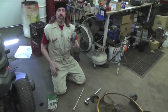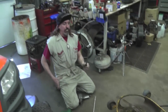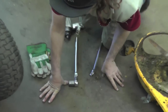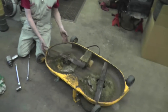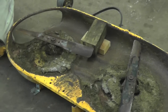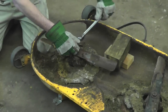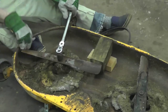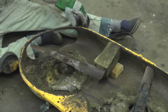Here at the shop we use an impact wrench on the blades, but if you're doing it by hand you want a good long wrench for leverage. You can also take the deck off, flip it upside down, put it on a couple pieces of wood, put your gloves on and work that way. Remember: righty-tighty, lefty-loosey. Almost all lawnmowers have right-handed threads. Get some leverage, take it off, and make sure you get it nice and tight when you put it back.